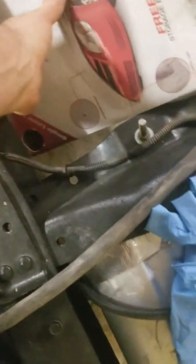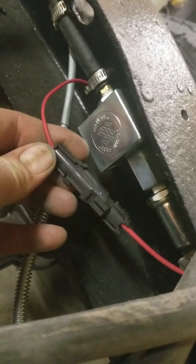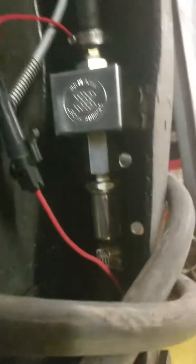I did all the wiring nice inside the looming. Back here the wire splits — one goes over for my fuel pump and into a nice GM weatherpack, which is a secure connection. There's my electronic fuel pump with the inline filter right there, and then the fuel line comes off from there.